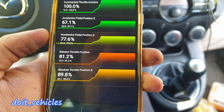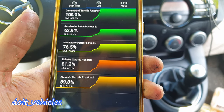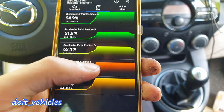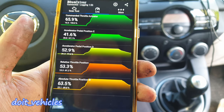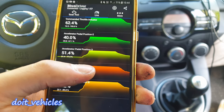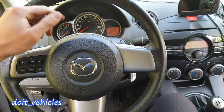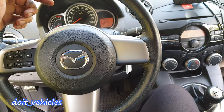They are basically topped up. Now let's see if it decreases slowly. It's also important that the decreasing and increasing is nice and steady and you don't see any sudden drop. That is what we are going to check when the engine is running — we are looking for those drops when the engine is basically stalling and then coming back again. Now we're going to remove the throttle body and clean it up, and see if there is any change when the engine is running.